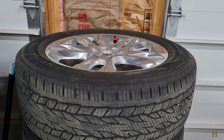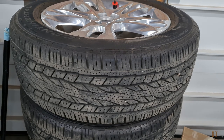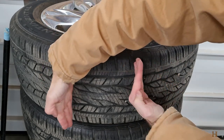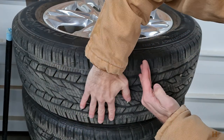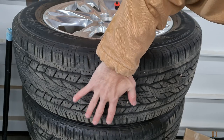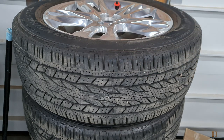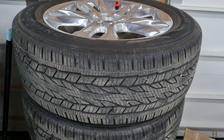You'd rather change your tires sooner for performance. Remember, when your tire is on the road, you have about this much contact surface at all times — a little more than a hand times four — and that's what's keeping you on the road. So you want good tires. Look at your date codes. If your tires are more than five years old, I would recommend you change them regardless of tread depth left. If your tires are over 10 years old, definitely change them.